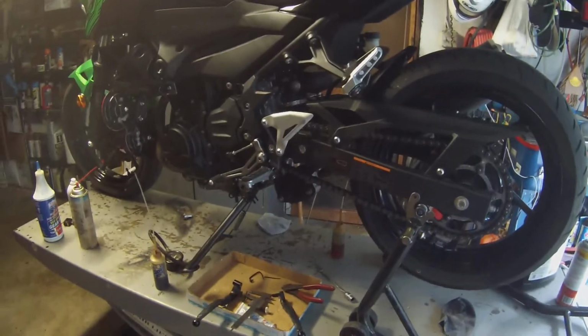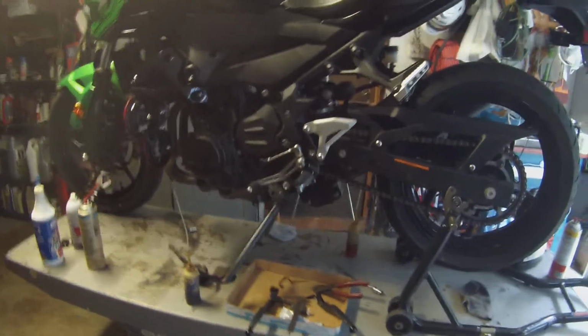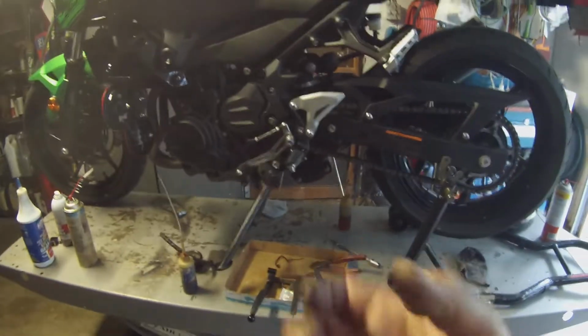And so I didn't shut the bike off. I thought it may not start again. I rode it all the way home. Turned out to be the side stand switch was going bad. It wasn't making good contact.